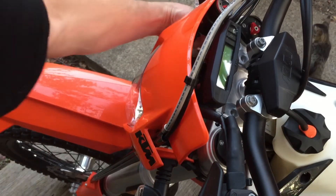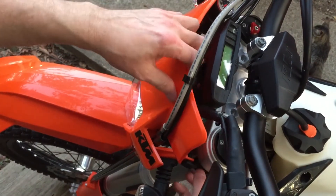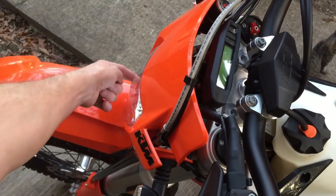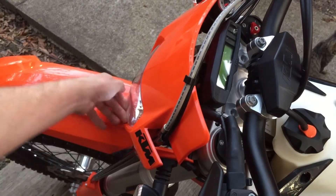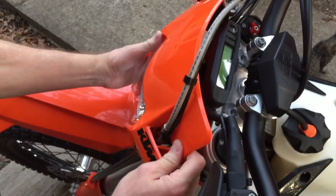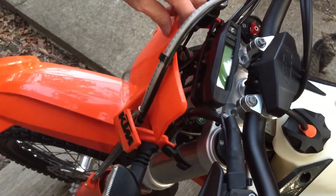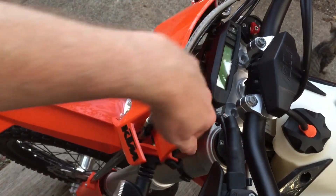And the one on the other side. This frees it — there are two little nipples that go down into holes on the fender. You lift that up out of that. Okay, there we go. This is all loose now — gives you some ability to move behind here.